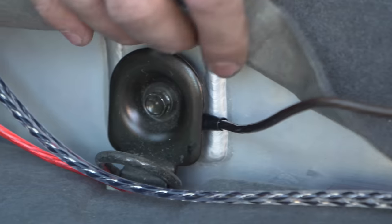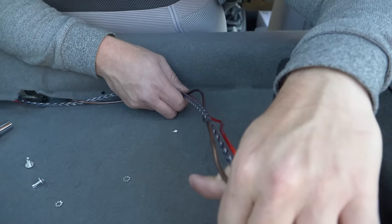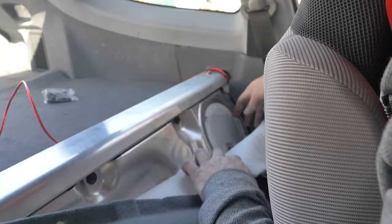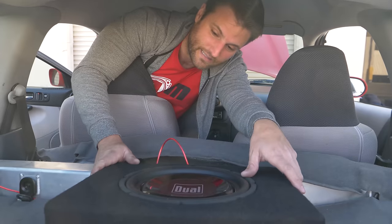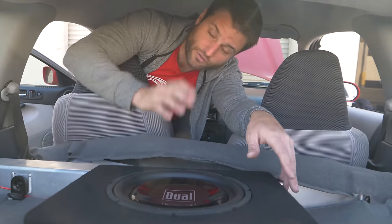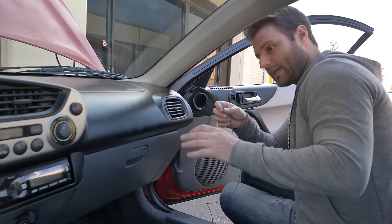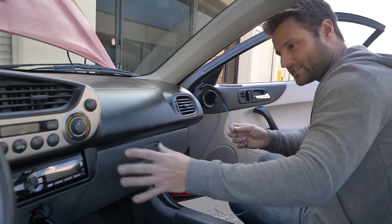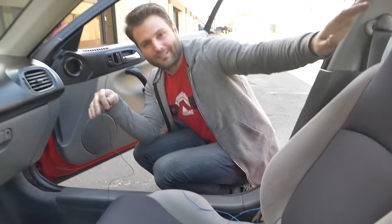This is about our closest spot for a nice solid ground. We're starting to collect the wires into a spot that can become a makeshift loom. Now that we've got power and ground ready to go, we need the ignition on and the two speakers. Something interesting about the Honda Insight, as well as some other economy vehicles, is that beneath this there is a plate for where a speaker should go. We're looking at all the different options on where to mount this, and this seems to be the best space — we can't fit it behind the seats. Please let me know in the comments where you think this sub should be placed. The remote turn-on is basically wired to ignition on, so we'll use the one from the head unit. We'll take it off from the passenger side, run it through the head unit, through here, and then run it along the whole side of the car and back to the amp and sub.